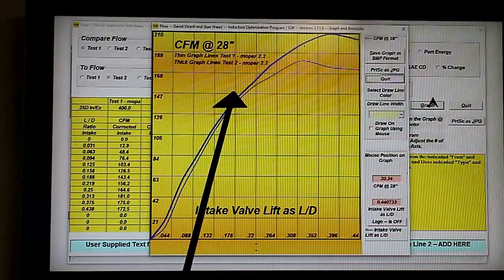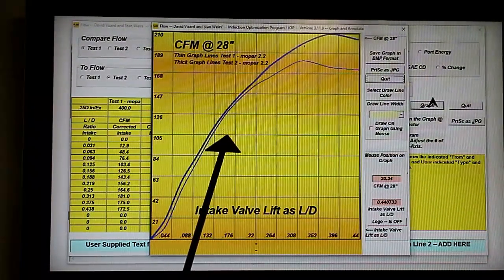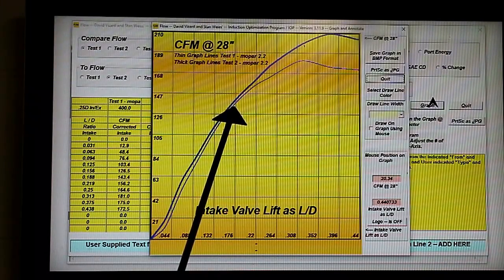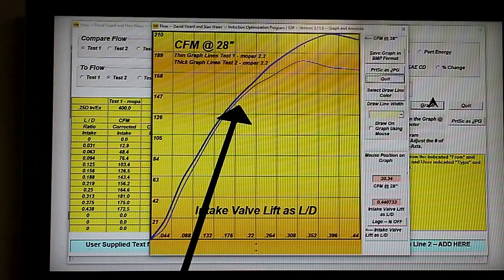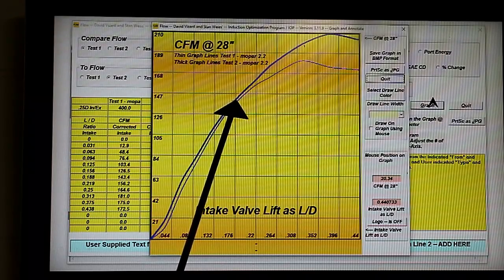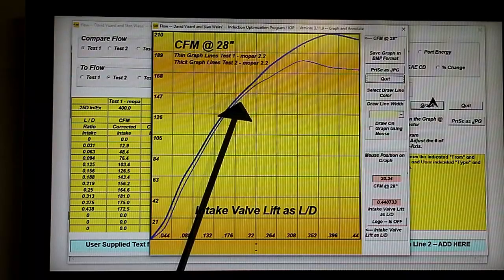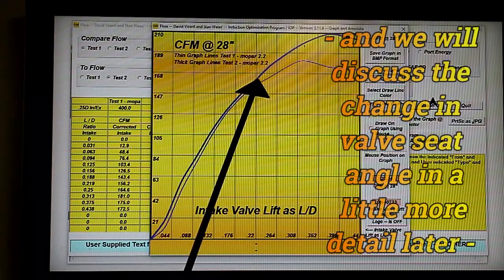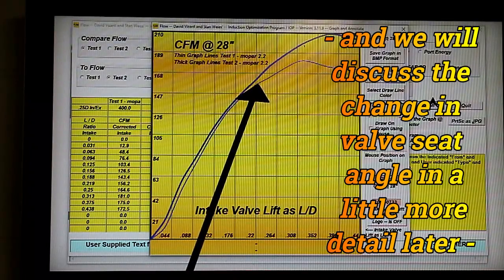Probably up to about here, it's the result of tidying up the seat. What I did was I cut a much better seat form there and I narrowed down the seat to about 65 thousandths and blended the underside into it — just a nice radius into the seat. This is a 39 degree seat versus the original 45 degree seat.